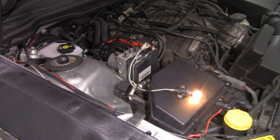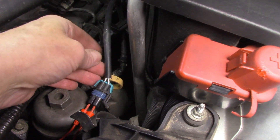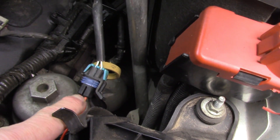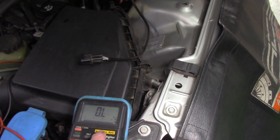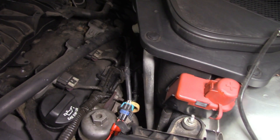See that pulsing? Look at that! So that's the duty cycle we mentioned — it was like 75% or something. The right-hand side is doing what it's meant to do. Now mirroring the test on the other side, we're now in the heater circuit of bank 2. You can see the two white wires and I've got a good connection. Let's have a look at the multimeter — this is an open circuit with its heater. Seriously? This guy was meant to have already replaced it. Where did he get his oxygen sensors from — eBay? This is a dead oxygen sensor.